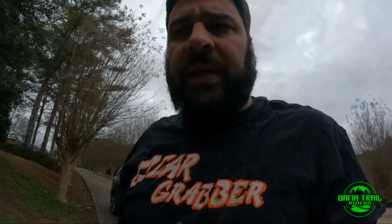getting there with an 18mm to get those nuts off is not fun at all. So I called James Shelley, said, hey James, what can we do here, and he got those bungs. So you're gonna grab a uni bit and go to, I'm thinking it's a 17mm. You got a 12mm right now, you go to 3/4, but it's a 17mm or 3/4, same stuff. So you go there, and we're gonna weld the bungs. It's gonna be a whole video on it, and we'll see how it goes and what it does.